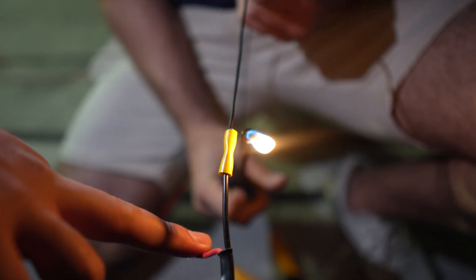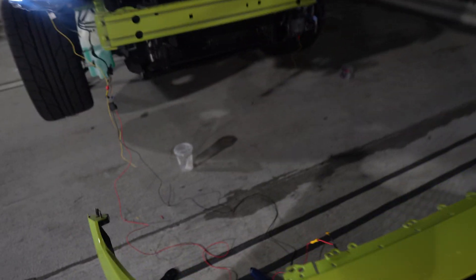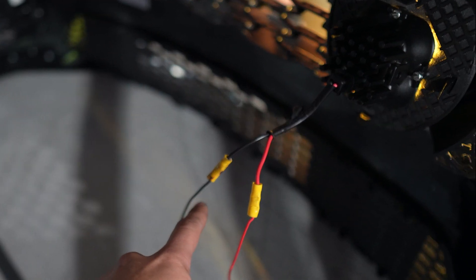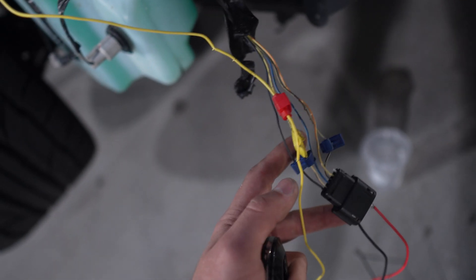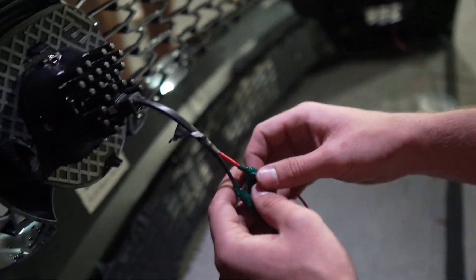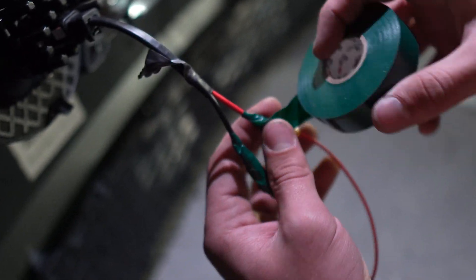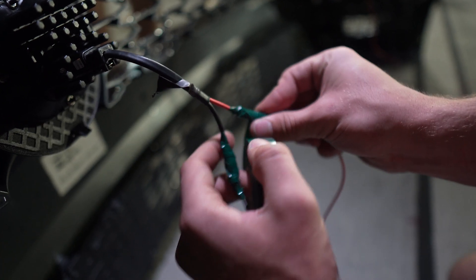It smells like burning plastic as we heat shrink - and there is the actual GTE fog light, it worked! I used the black wire to extend from the pigtail harness from Amazon, ran it through here. The black wire goes to black on the turn signal harness, and red goes to yellow and orange. Heat shrinks are all done on this side. You probably want to wrap it up with tape so moisture doesn't get in - it's heat shrinked so it's weatherproof, but just for extra reassurance. Same process on the t-taps.